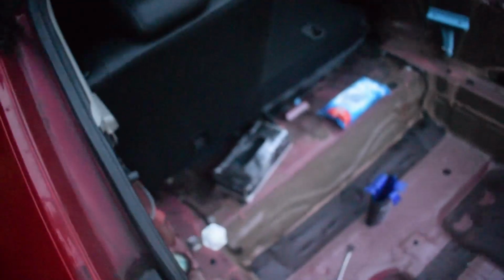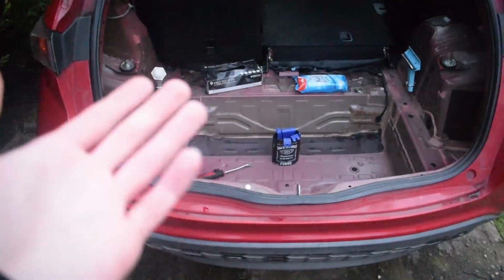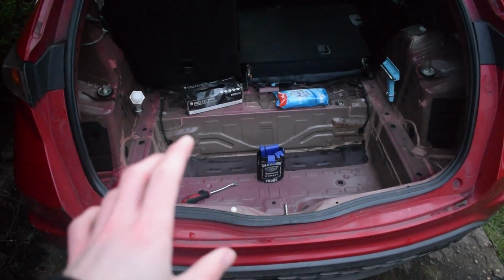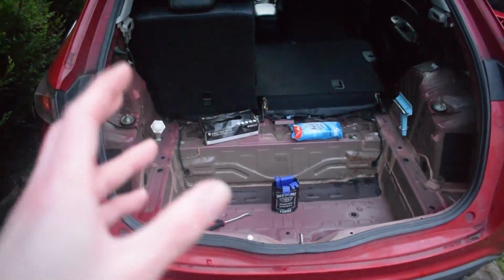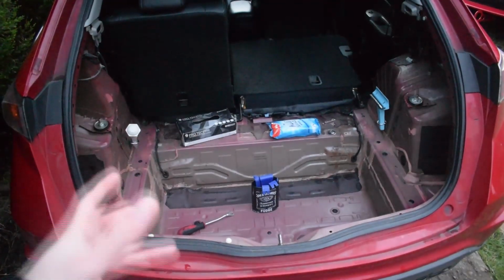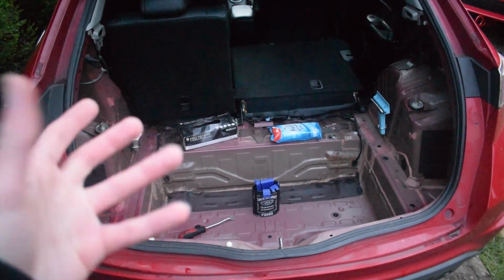It takes about 45 minutes to have its strength and 12 hours to properly cure. So what I'm going to do, make sure it's not tacky anymore, we'll put the roof strips back on, shut the boot, make sure none of it's catching, and then we'll wait until tomorrow, and if it chucks it down tonight, we'll know for a fact whether it's leaking or not, because it'll come in. If not, I'm going to get the hose pipe and have it going onto the car somehow, or I might just cover it and then get inside quickly, but have everything closed and see if I can see where it's coming through. But we'll wait until tomorrow to find out what that's going to be like.